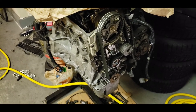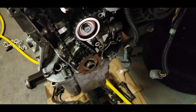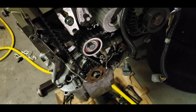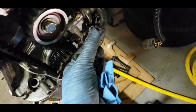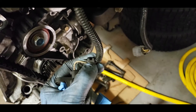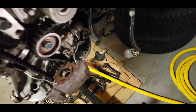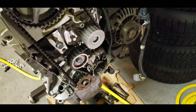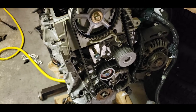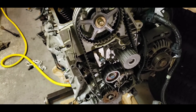Here's my D16 Y8 motor. I've removed the crank sensor because I'll be running OBD1 and it won't require it. It had a little grommet that fits in this slot here - I'm going to cut a couple slits in here, pull the wire out, and use this so no dirt gets in there when I put the timing cover back on. I'm also going to be putting in the A6 bracket and will probably have to modify the timing cover a little bit.